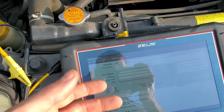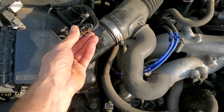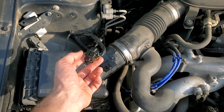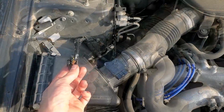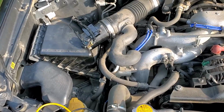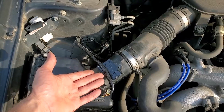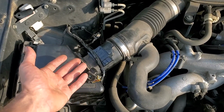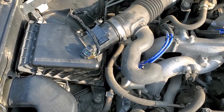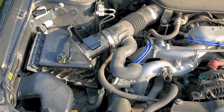No signature test in the lab scope. It looks for 12 volts on the power supply, which should be the center of the 5 pins. Should see battery voltage with the key on, engine off. There's no voltage on the power in. So time to pull the wiring diagrams, go into the flow chart for the P0102 from the service manual. Pull all this off of here, see what we got going on in here, see if we got a wiring splice that's bad or something's shorted the power to the ground. Hopefully this brand new mass air sensor hasn't been hurt, and hopefully the PCM is not hurt.